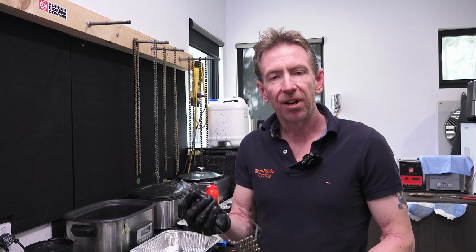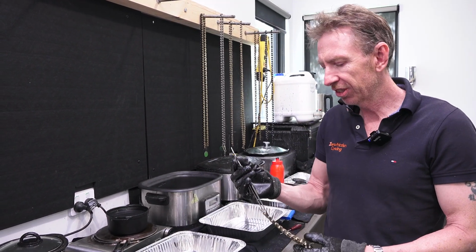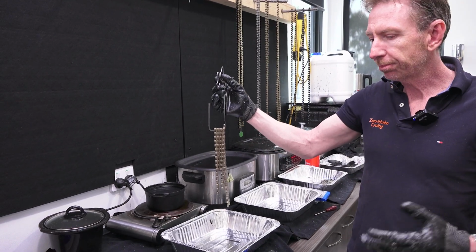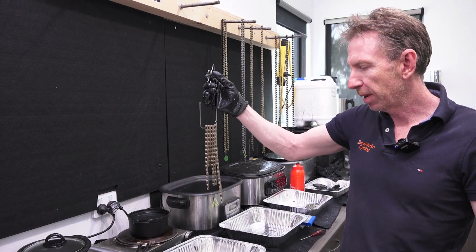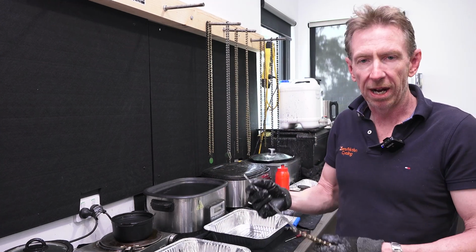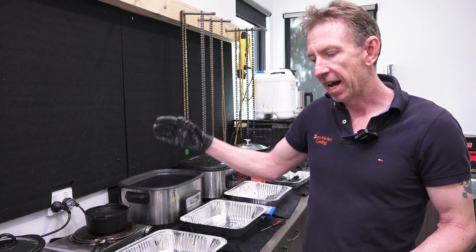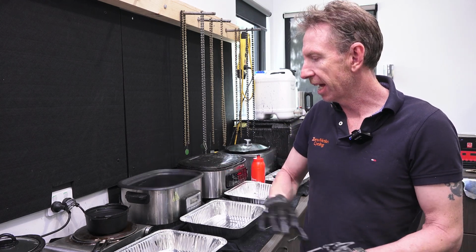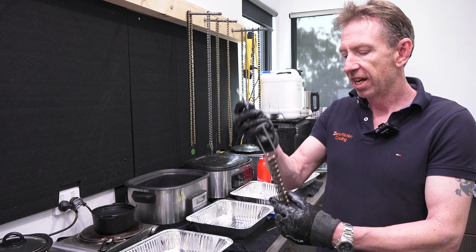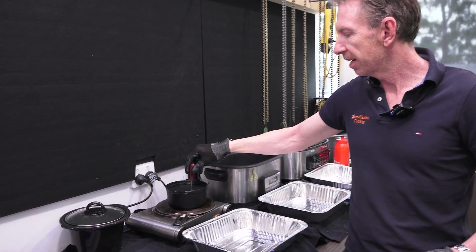Alrighty, so the last part of the epic waxing FAQ video, showing you how to do the two-pot system like a boss. Normally, most people with the two-pot system put the chain into pot 1, and when that's melted, swish it around, let the wax drip back out, and then move it into pot 2, getting overall more waxes per bag. But over time pot 1 is going to get a higher level of contamination brought into it, and if it's allowed to just swish around, you are going to be mixing that contamination in with the wax. So the two-pot system is great, but it can be even better if you take just a little bit more setup initially, but once it's done, it's done.